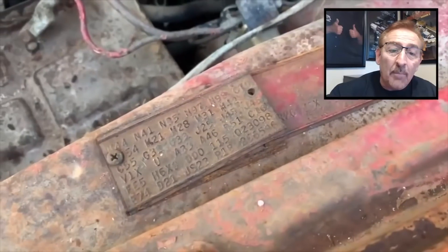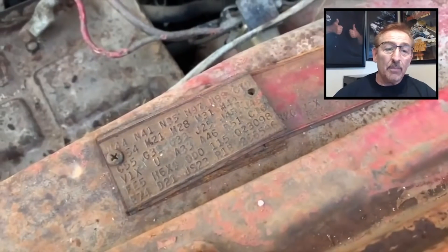Look at the fender tags — there are actually three of them. There's the top one filled with codes, the one on the right-hand side with the R26, which is AM/FM cassette, and underneath it you see a third one. If that were out and exposed, it would say 'Hemi' fender tag. Take your time and learn those codes.